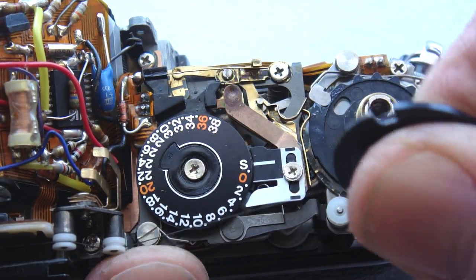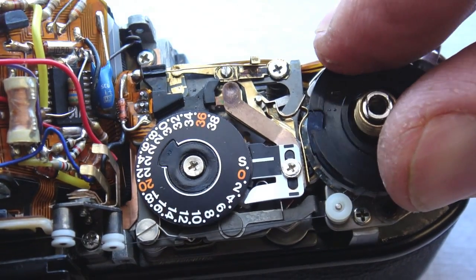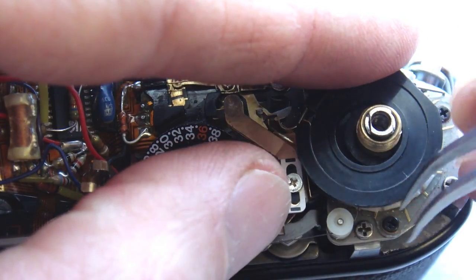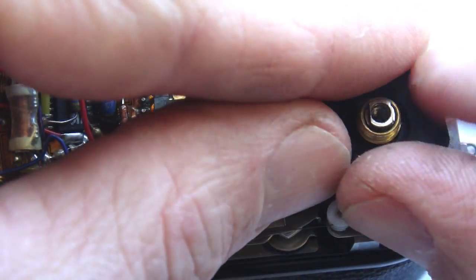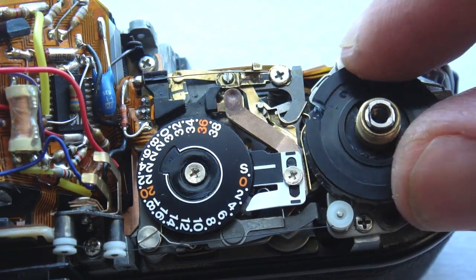Again, with the meter link plate in position, check all the pulleys to make certain that the wire is traveling in the center of the pulley. Use the tweezers to position the wire properly. Check to make certain that neither the wire nor the plate binds.